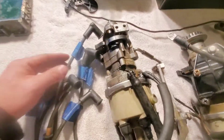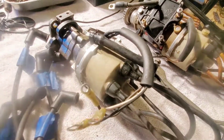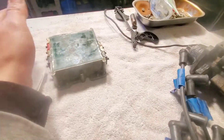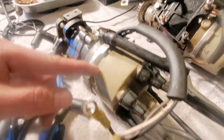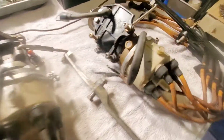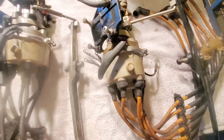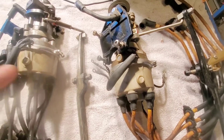I got this distributor. I'm working on a 1972-1150. I was getting a no spark. I verified that the switch box and the coil were good. I tried turning the key and got no spark. What I'm thinking is a bad trigger in here. So today I do have a backup for the backup right here, and I'm going to test this trigger and show you guys how to test the trigger on the distributor models up to 1978.